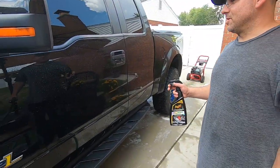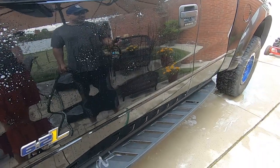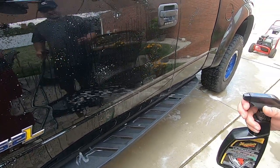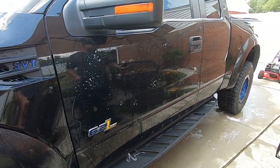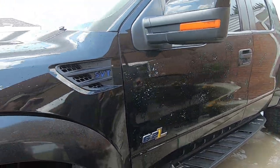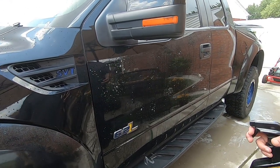All right, now we're gonna do some decon after washing it. That'll help strip the wax he has on here — he's got a nice coat of wax. We're going over the whole vehicle to make sure we don't have any iron on here, trying to get the paint as clean as possible. We'll let it sit for a minute, then rinse it off, and then we'll do the tar next. After the tar we'll do a clay bar — just showing some quick steps.